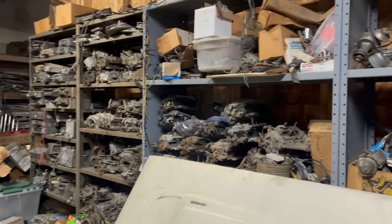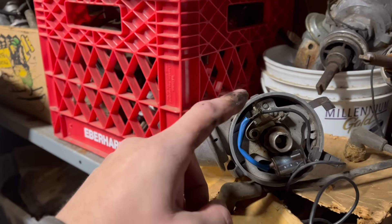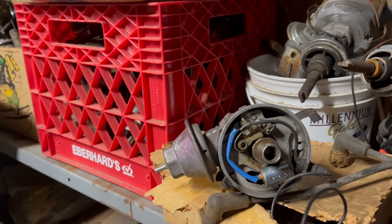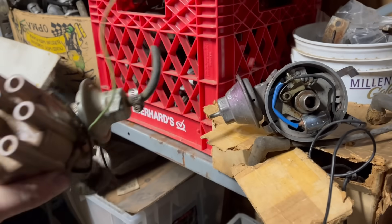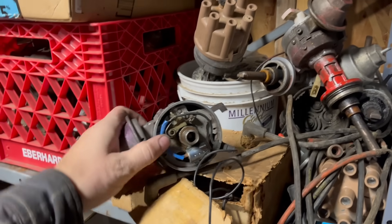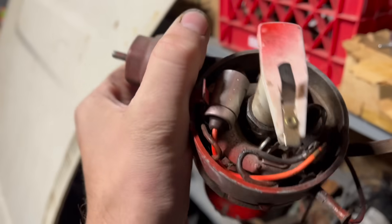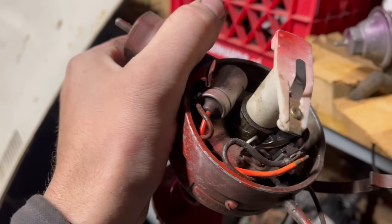And parts, we have — just a few. What we're looking for here is the common single-point aluminum body distributor that was used by Chrysler from sometime in the '60s until 1972. It's very similar to the big block one, but on the big block unit the vacuum advance points the other direction, so it's easy to spot. In big block land there are multiple heights depending on which big block; in small block land there's just one. There's one now. It's red for some reason — that's interesting. It's the aluminum body, but it has the earlier style bearing plate instead of the magic floating one.